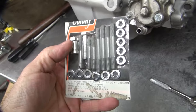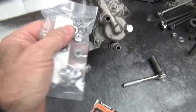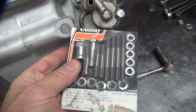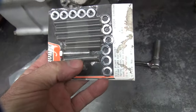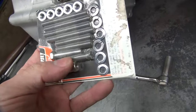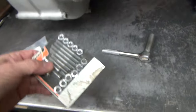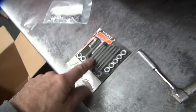This kit has the tall nut in it. You need it for right here on the oil pump — there's no room in here to put a regular nut in there and tighten it. This gives you the new bolt. The bolt in here is 1/4-20 thread, which is what this is, so I guess that is stock. That's the only 1/4-20 bolt they were using on a knucklehead.